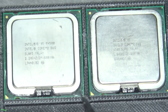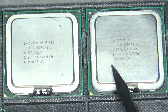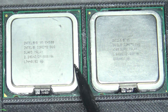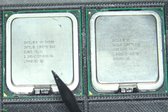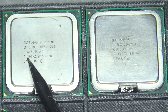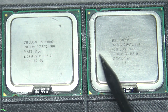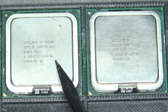So here's what I'm going to do. We've got these two CPUs here — you can see this one's a 2.2 and this one's a 1.8. They both have the same amount of cache and they both have the same front side bus. The only difference between them is the multiplier, and that's unfortunately locked by Intel. We can lower the multiplier, but what's the point of going slower? We want to go faster. So I want to up the front side bus to make this 1.8 into a 2.2 and see what the performance is like — is it similar, better, or worse than the actual stock 2.2?